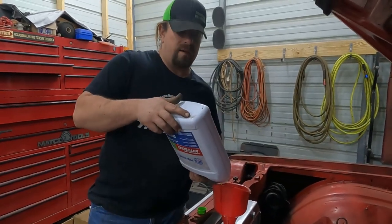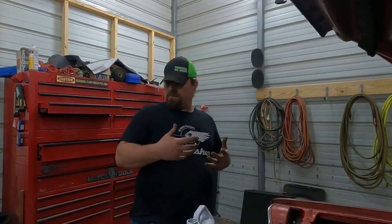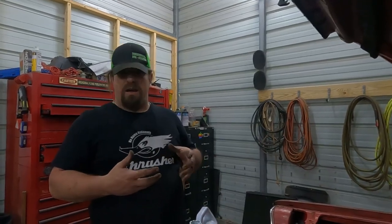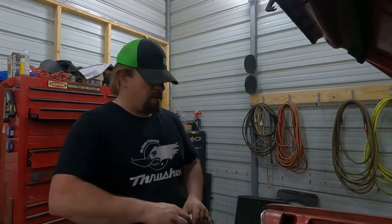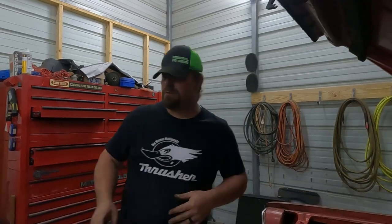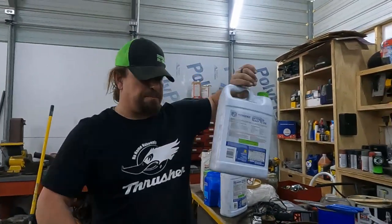That being said, I need new power steering hoses anyway, because the one that was on there was too crimped, hydraulic hoses hooked together with a union, and the rubber was all cracked and falling off and wasn't gonna work. So got that done. I plugged a whole bunch of vacuum leaks. I hooked the choke pull off back up because it wasn't hooked up.